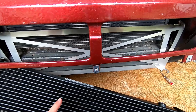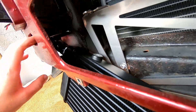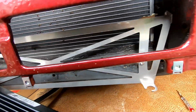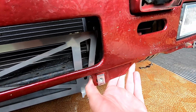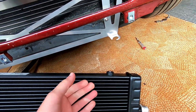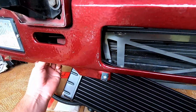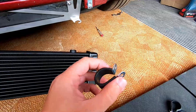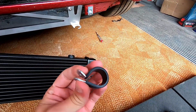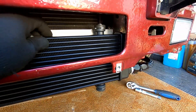I've already mounted the hose on the oil cooler and shifted it up there. I found I didn't need to dismantle the front panel — I just unscrewed four screws and moved it slightly forward, which let me shift the cooler up into position without removing the whole panel. Once it's in place I'll create some holders for the hose and route it to that side using these fittings. The oil cooler is now in place with the OEM rubber bushings — it's all nice and solid.